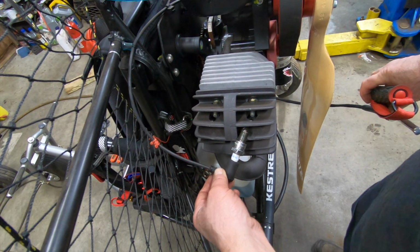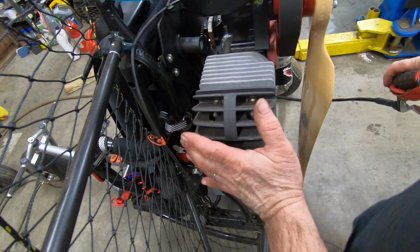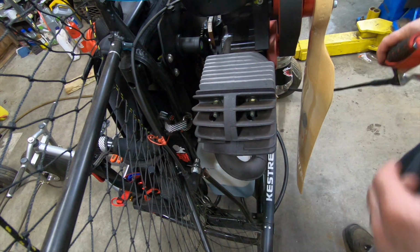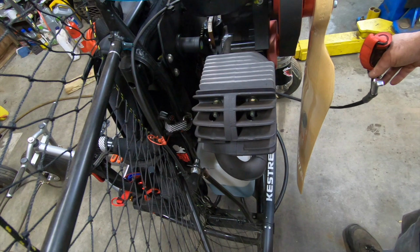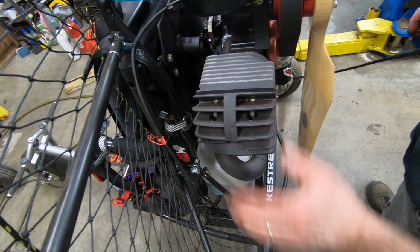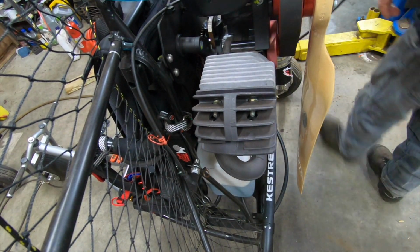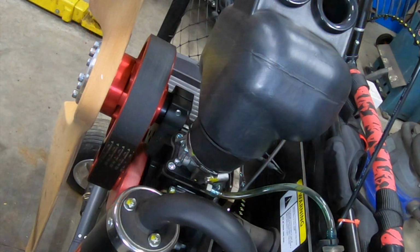Beautiful spark. Yeah, kind of what I suspected. Nice forceful flow of air coming out of the plug hole too. So we know everything's good. When something sits, it's a sure bet that you got a carb problem, especially if you drain the fuel on a diaphragm carburetor. Okay, this is a Talon 190 two-stroke.